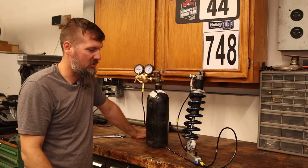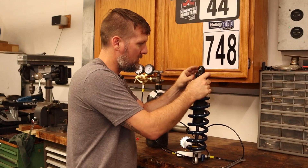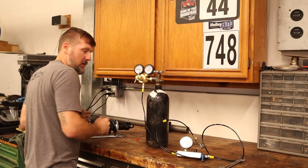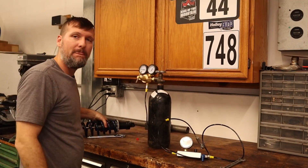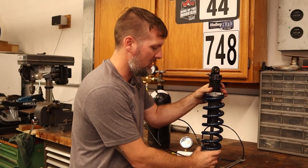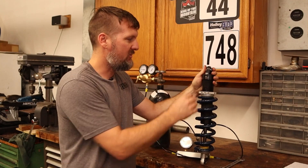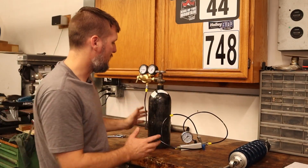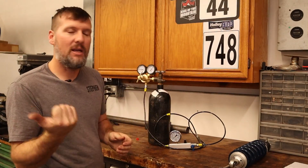If they were completely drained of nitrogen, I'm sure topping them off will probably give us a little bit more height. The shock is all done — we can get it reinstalled into the car. I still need to check the other one, but that one is currently already installed in the car. We can do this all on-car — just jack up the car, easily reach in there, we don't even take the tire off, which is really nice. This whole setup was probably about $200. Need to get them back onto the car, but that is it for this video. Thank you guys for watching, we'll see you in the next one!